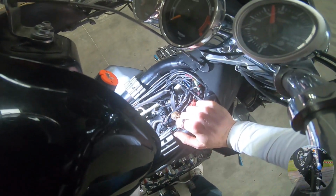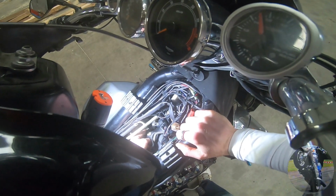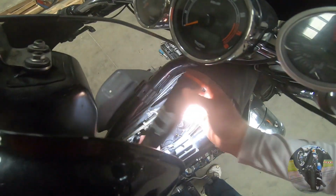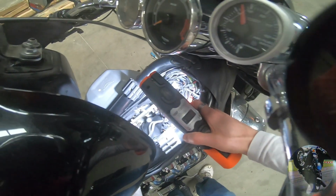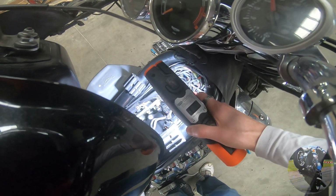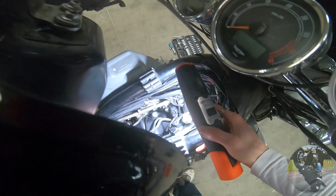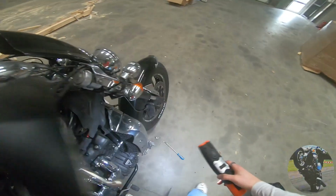Now, you've got, see this screw here? That is the screw between throttle 1 and throttle 2. That's the balancing screw between those two. And if you can see it, hang about. See this one right here? That's the other one. A little bit of yellow paint on it from the factory. When the throttle's balanced, what to do is to put a bit of yellow paint on it just to mark what the balance point is. This is your vacuum tubing here, which leads the 3 into 1, going up to your map sensor.